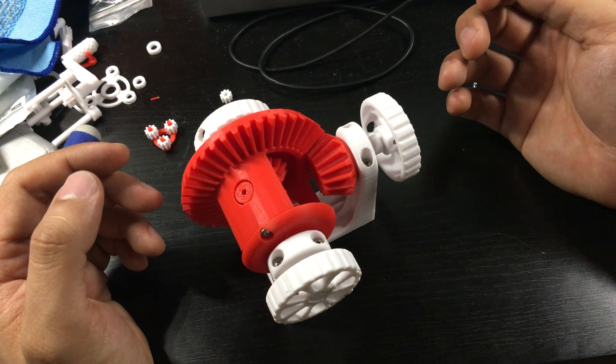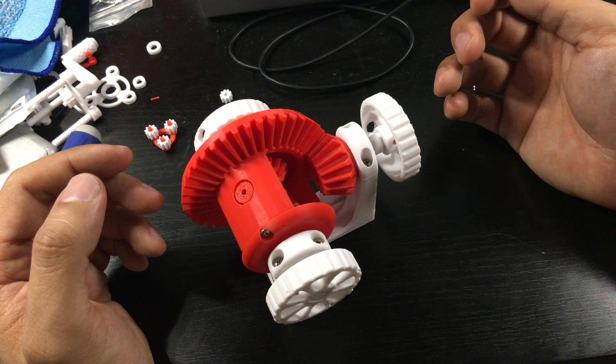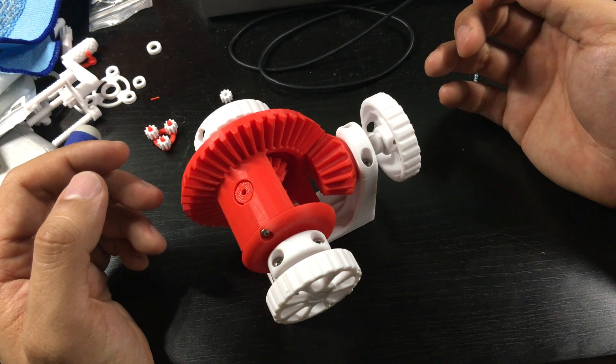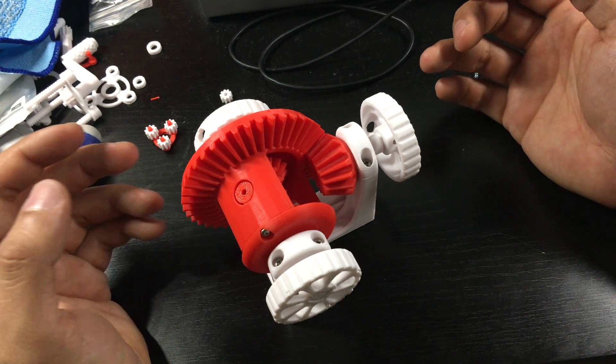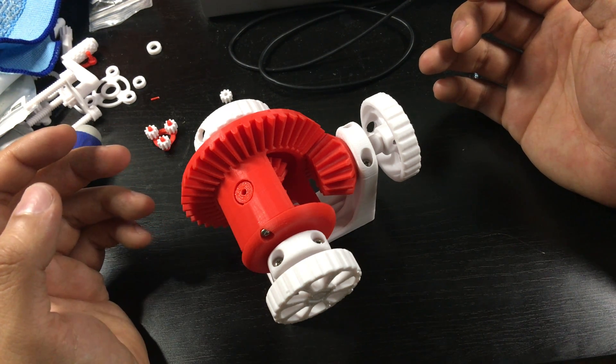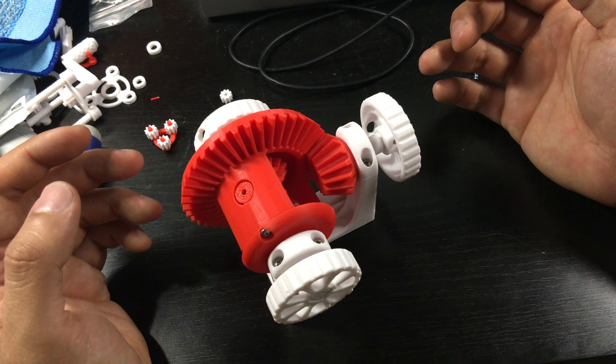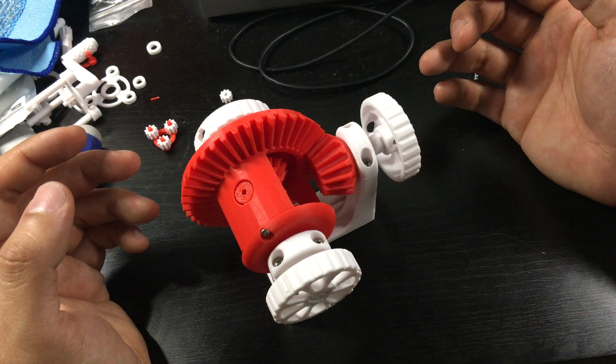Additionally, when you're doing huge turns, your outer wheel is traveling faster than your inner wheel, so again you're going to get slippage — one of your wheels actually starts sliding. And so for better grip, the differential was created.